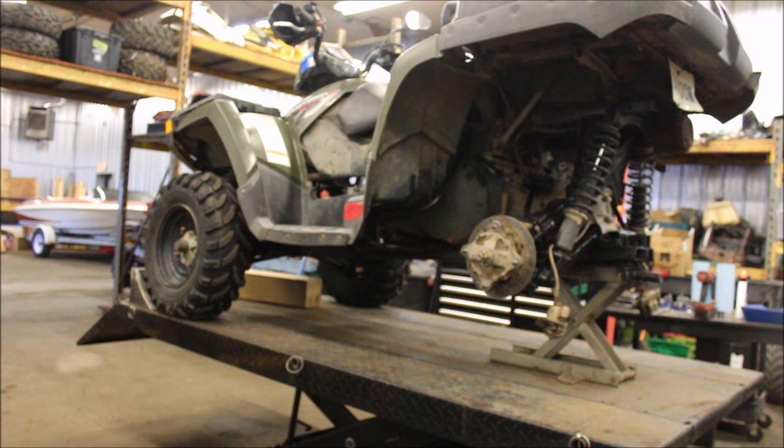So I bought this, and the guy said that there was an issue with the transmission. It's probably going to need to get replaced. So in my mind, I'm thinking, okay, with what I paid for this, it might be a $300 part if I rebuild the transmission, or it could be $1,100, depending on what the issues are. So, me being me, I'm a little bit of a gambler. I rolled the dice, hoped for the best, and let me show you what I found.